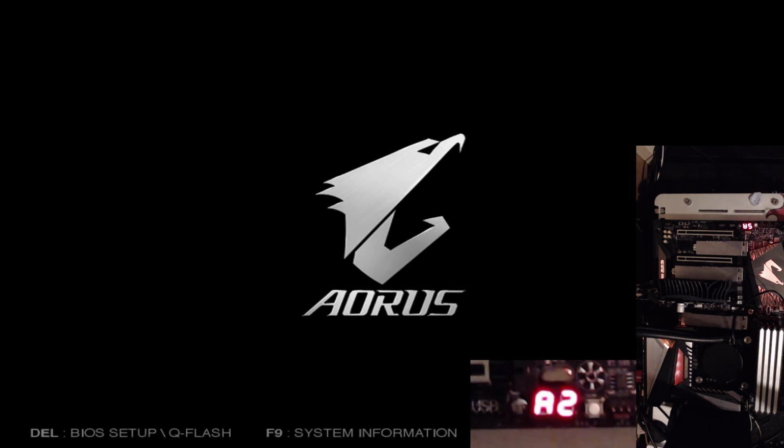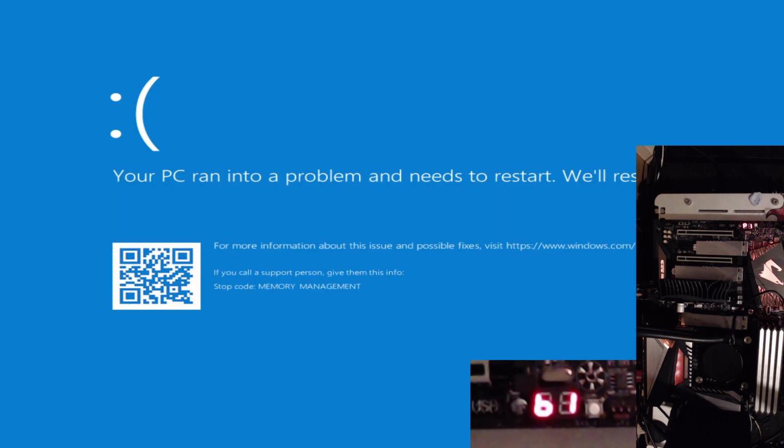So at least I'll feel like I achieved something. Come on. Please don't make me look stupid. See? Well, that's not supposed to happen. Okay, there. Now if we make it to Windows without crashing, that would be what I am hoping for. Okay, I think, oh, right, we're back on 1.2 volts VCCIO, aren't we? And I'm like, oh yeah, we're totally going to get into Windows at 4533 megahertz, aren't we? No surprises there. That poor memory controller. Too much data, not enough voltage.